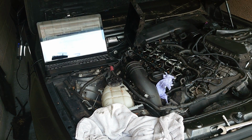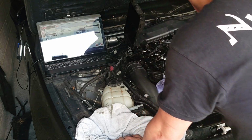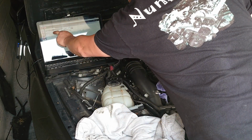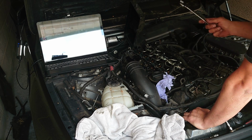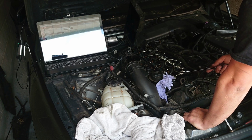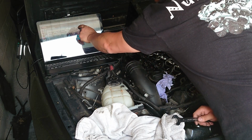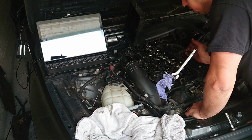What I have to do is just start the ignition, just press start. Then you go in here and press OK. Now we have to keep an eye here, because when the diesel starts to circulate, first I will tidy up this one. You can hear the noise. What's happening now is the computer pressurizes the system, so it sends the diesel in here. I can see it. So I will stop, and then I will try again. Start again. And now we'll open this injector here.